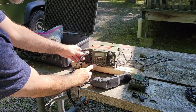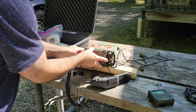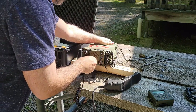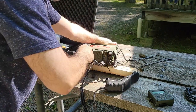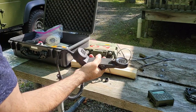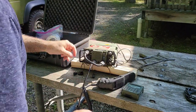It's getting a little loud so let's put squelch on. Now the radio is squelched. We'll take the keyboard display unit off and replace it with the speaker mic unit. For more detail on this whole system I've got other videos on my channel. We're going to move the handset to this one, and then we need a jumper from this connector back to the radio — that's how audio gets into the speaker mic through the handset connector on the remote. It'll fully operate, but you can't control the frequency and other things. If you're working a fixed frequency that's already been set in the truck, you're ready to go.